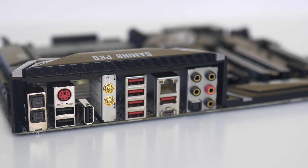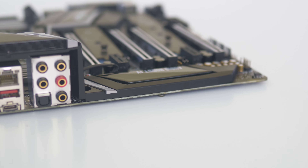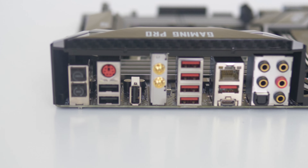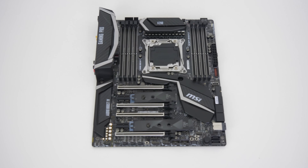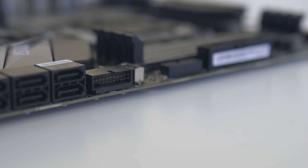The main difference between Gen 1 and Gen 2 is that Gen 1 has 5 Gbps throughput whereas Gen 2 has 10 Gbps. To round it off we have 7.1 3.5mm audio jacks and an optical S/PDIF audio out. In terms of what's powered by what, ASMedia power the USB 3.1 Gen 2 ports and three of the USB 3.1 Gen 1 ports on the rear panel, with the rest powered natively by the X299 chipset. On board there are two USB 3.0 headers — one right-angled and one not — for better cable management.